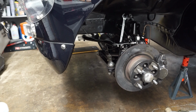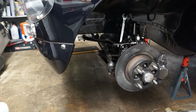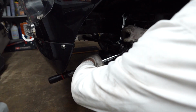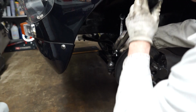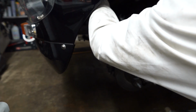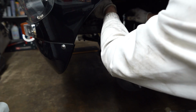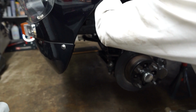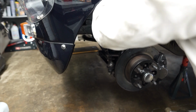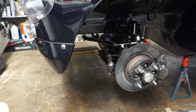So now I'm just left with the anti-roll bar link bolt here, which is 81 foot-pounds. So let me just see if I can get the torque wrench in. Unfortunately, the access isn't great really. I might have to see if I can get inside the wheel arch here. That's a bit better. So that's this side torqued up. I'll go and put the bolt back in the other side too.